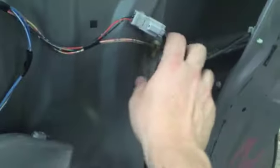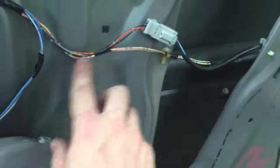Disconnect this, disconnect this, disconnect the lock, and disconnect here going to the key — and this going to the lock actuator. You're going to disconnect the lock actuator. Here's the fun thing you have to deal with — this is the track for the window. You're going to need to take it off to get access because you need all this space. There's a screw for it back here. The rubber piece stays, but there's a metal piece behind it — slide it out from under the rubber piece, then work it back in when you're done.